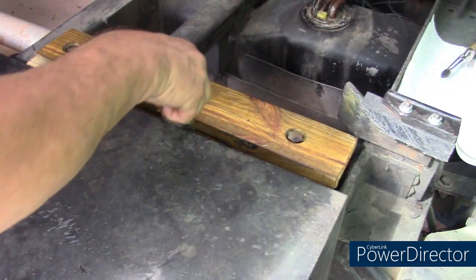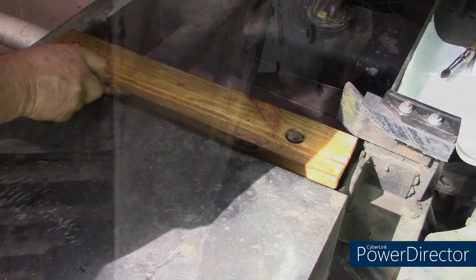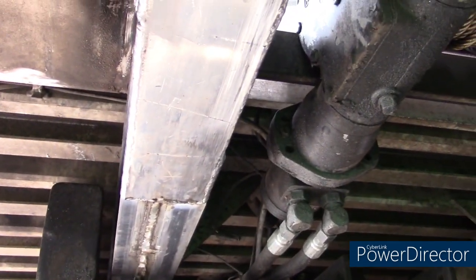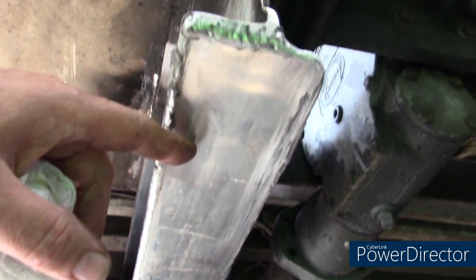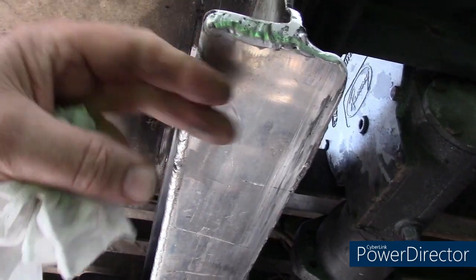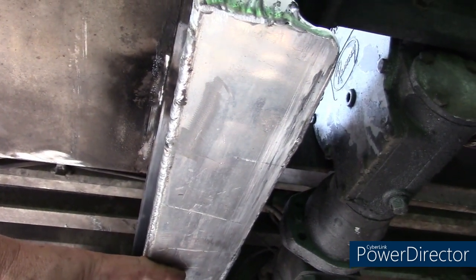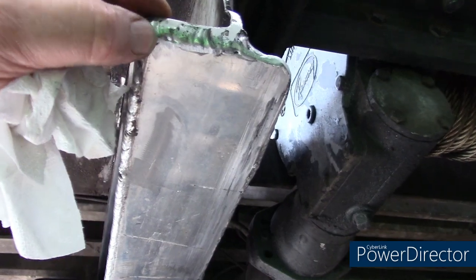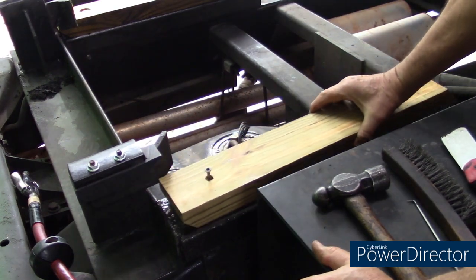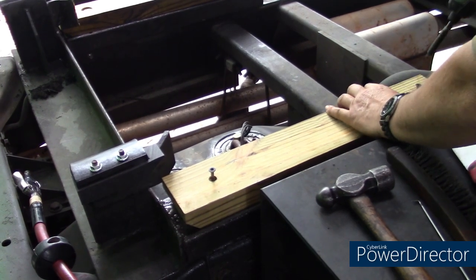On this old truck we're going to be on our own keeping this bed in shape. You can see the pad I had welded on down here was a pretty bad repair — it was tearing up what wood we had, all the way forward. I had this pad welded in and it's going to ride nice now. That does make up some thickness, so the measurement of two inches was what I came up with to fill in, but we only had about a one and three quarter piece of wood — this is a quarter-inch thick piece of plate, so I think we're going to be alright.